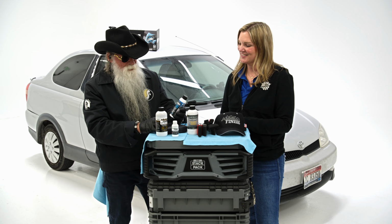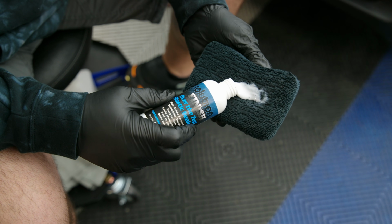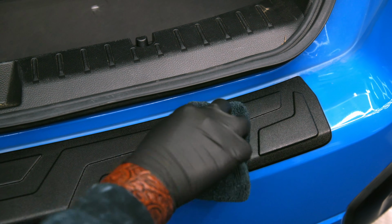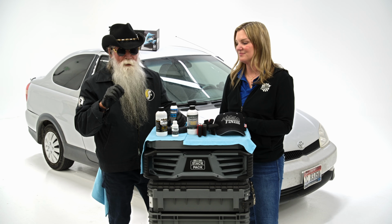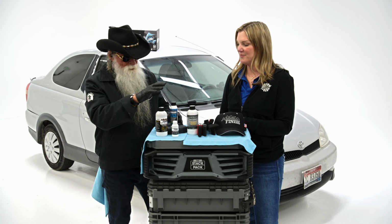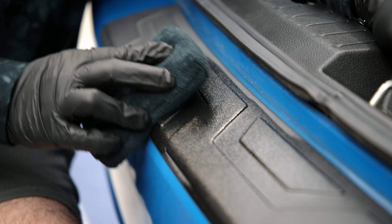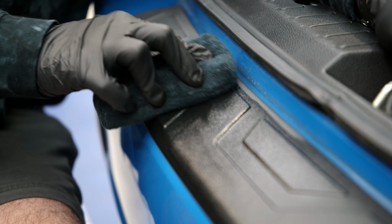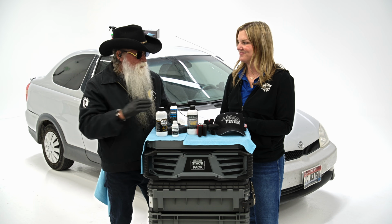Through the years, I developed the over-the-top plastic sealer. Now, it's not a ceramic coating. Everybody kept trying to put ceramic over it. But once it oxidizes, you have forever locked out Solution Finish's ability to absorb into the microscopic pores of the plastic, which defeats the whole purpose. So you try to put it on Solution Finish later and it smears, it's blotchy.